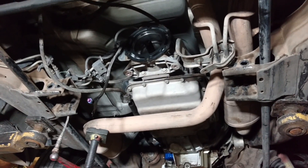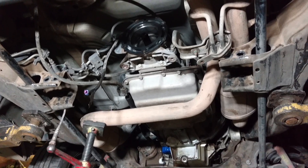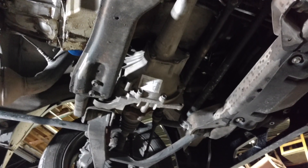I'll just have the 4-wheel drive transfer case in there instead of the all-wheel drive one, and I'll be able to take out the whole front diff and the axles and save a ton of weight and a ton of drag, and it'll give me more top end.